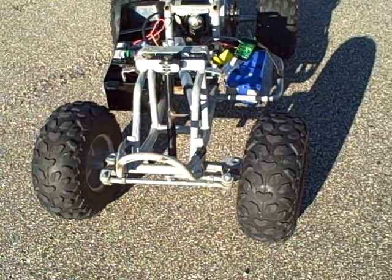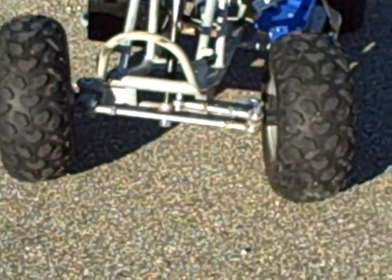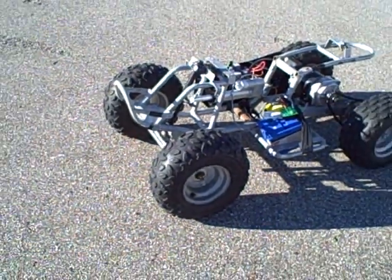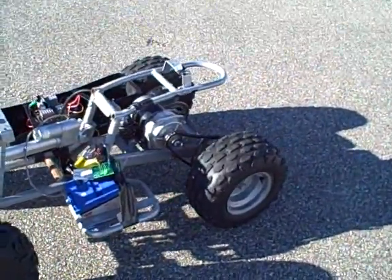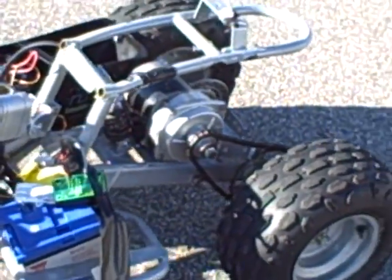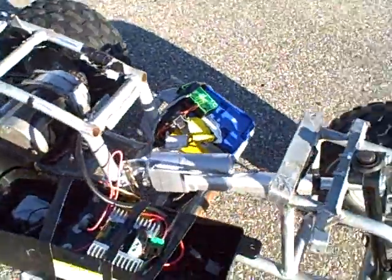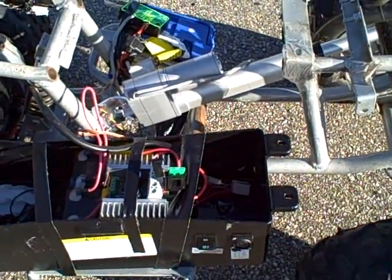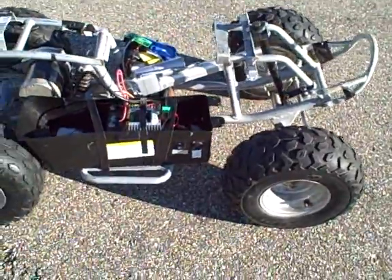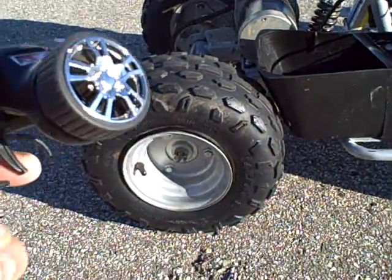This little thing rocks. Let me zoom in a bit on the tie rods - this thing works like a charm, flawless. I know a lot of people are into Power Wheels; I thought about doing this with Power Wheels and I stumbled upon this quad for 30 bucks. You can't even buy the chain and sprockets for 30 bucks, let alone the tires - it's got good tread. That motor is the beef. The motor's rated at 36 volts 800 watts, the Sabertooth 50 is a 24-volt setup, runs perfect on 24 volts. It's not dangerously fast, and most importantly this thing is so precision-controlled.